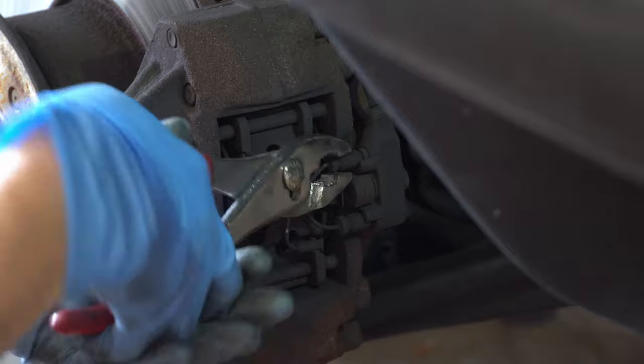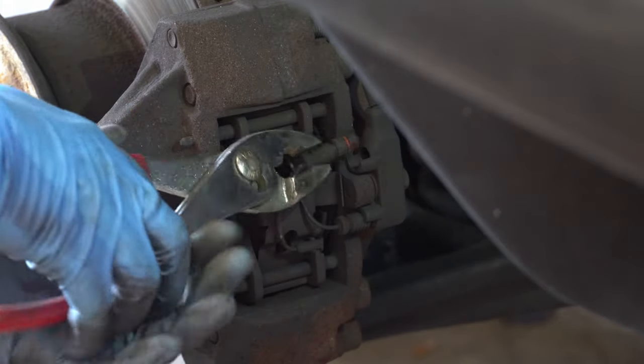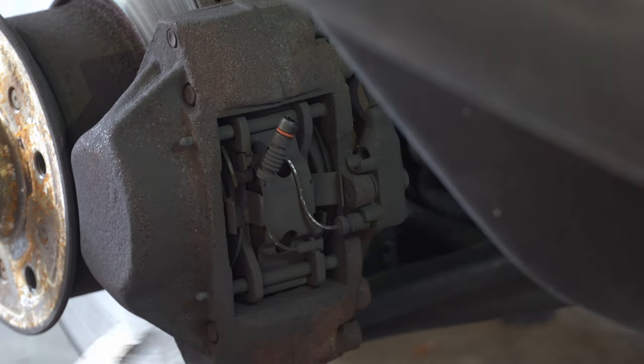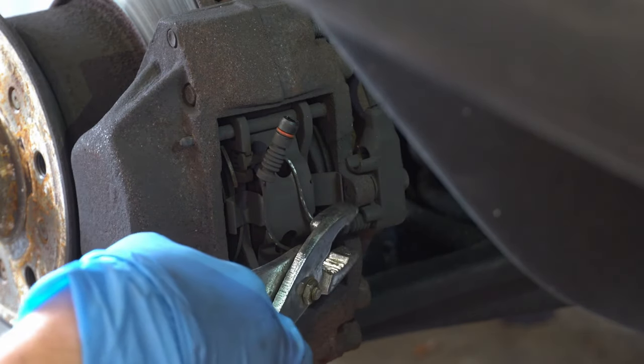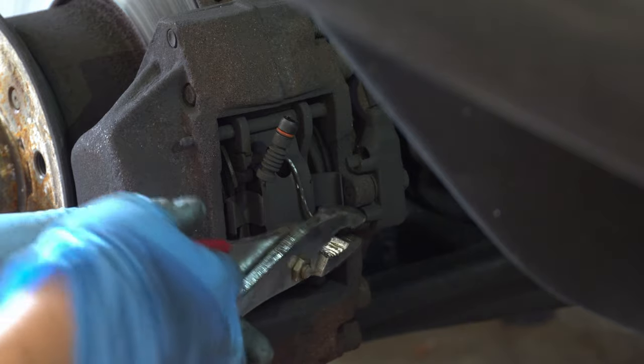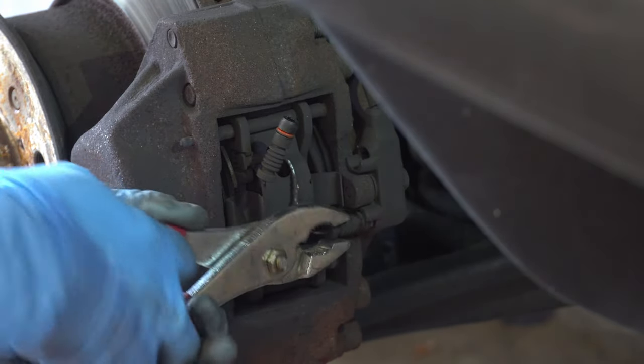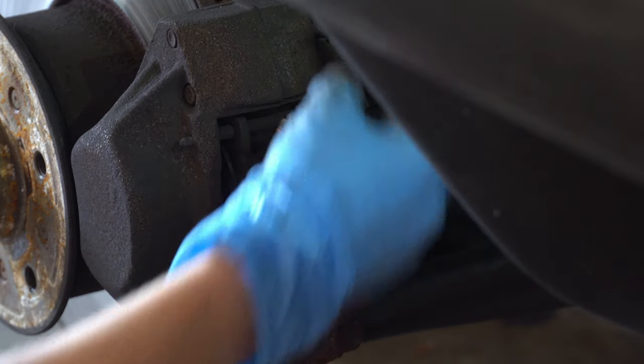To start, we're going to remove these brake pad sensors. You can pull these out — if you plan to reuse them, be very delicate. They're about a dollar each, so go ahead and order some new ones with your brake components. I was able to reuse mine because I forgot to order new ones, but while you're doing everything, go ahead and spend the extra two bucks to take care of them.